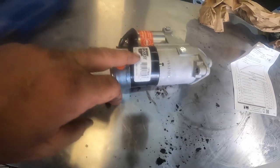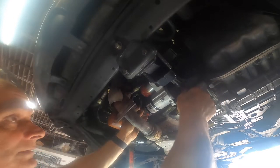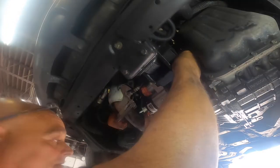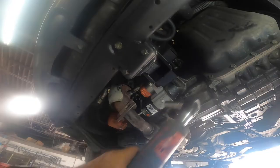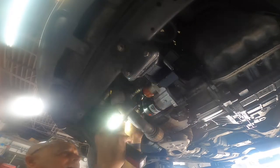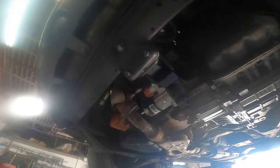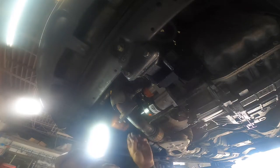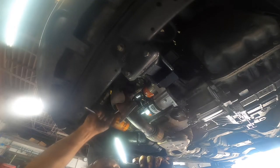This is the starter going back in — it's a CarQuest. CarQuest has not sponsored this video, I just happen to use their products. The biggest part of this job is just trying to stay clean because it is nasty. It came with a new lock washer and a new nut, so make sure you go ahead and use them. Now before I go any further, I'm going to bring it down and go ahead and hook the battery back up and start it just to make sure that it starts correctly.